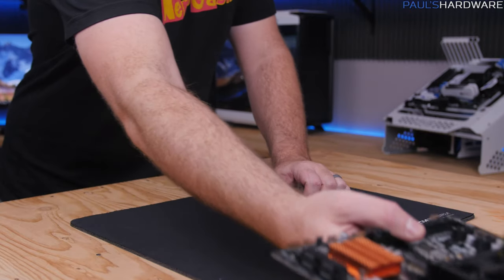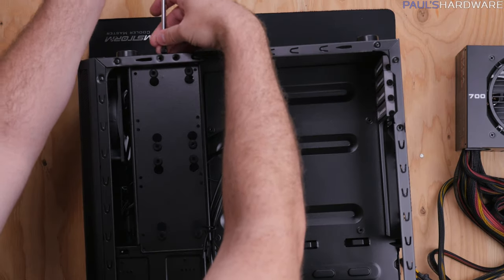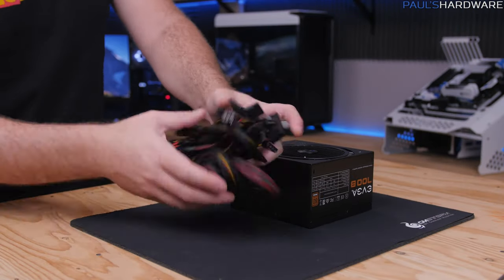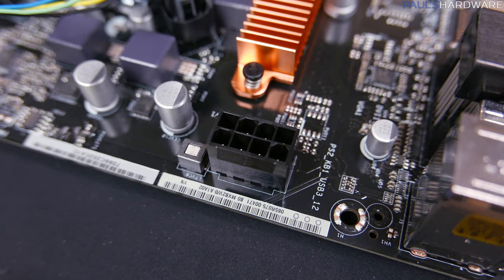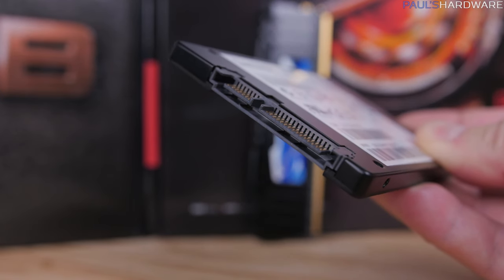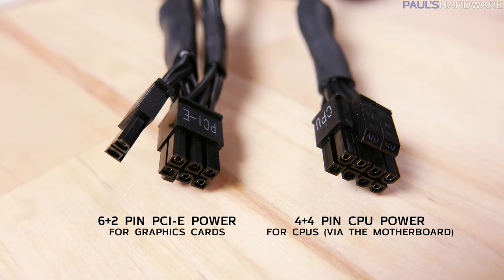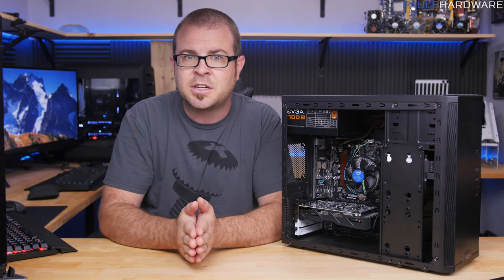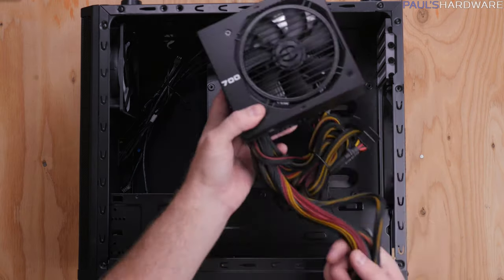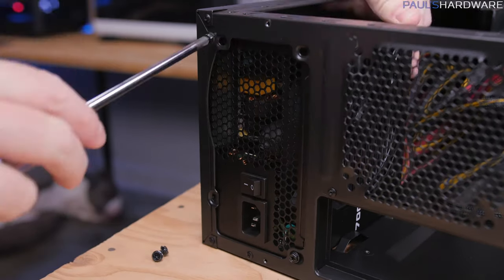Let's set the motherboard, CPU, and memory assembly aside for a moment and work on the case and power supply. Remove the case side panels and the vertical drive mount that's right up at the front, and prep the power supply by unbundling just the cables that we need — those are the 24-pin and 8-pin plugs for the motherboard, and the SATA power connector for the SSD. Note that the 8-pin is labeled CPU and should not be confused with the 6-plus-2-pin connectors for graphics cards, which we won't be using in this build. Bundle all the unused cables up so you can shove them in the drive bays at the top of the case, then drop in the power supply and secure it with the four screws from the back.